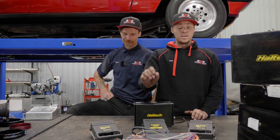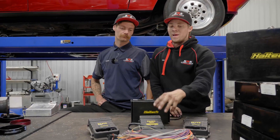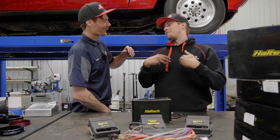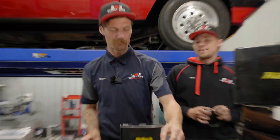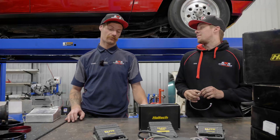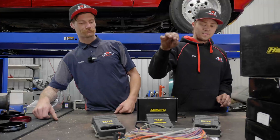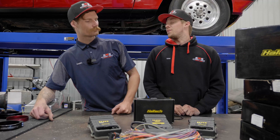It's a perfect way to start fresh, especially if you're going to spend the money on the ECU. If you're spending money on the ECU but using a factory harness that's been adapted and messed with over the years, you may as well not — because your ECU can only know what's going on through the wires bringing information to it. Brandon wants to grab that stock loom to keep it for any plugs he might need off it, then he's throwing it in the bin.